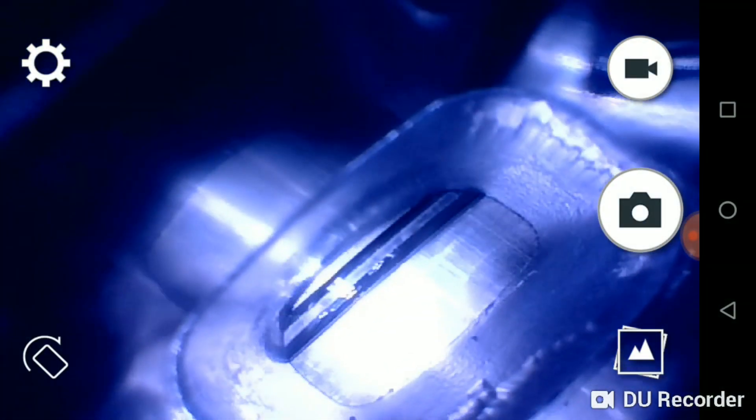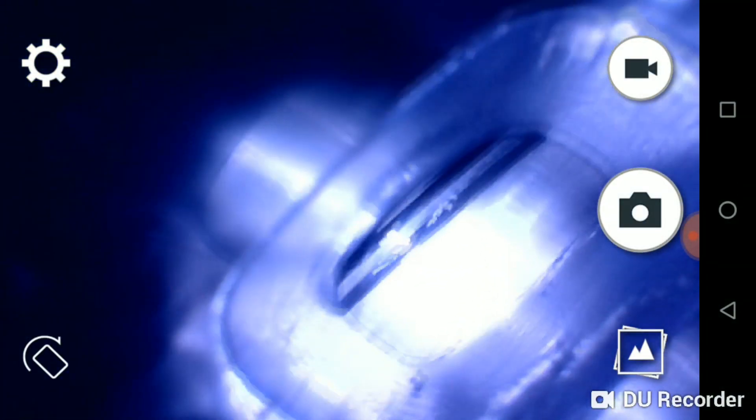The spattering or speckling that you see on top of that piston head is most likely carbon deposits that have been left from the factory test. As we look at the walls, you can see there's not really any scratches, there's no marring. When we take a look at the carburetor side of things, you can see everything looks nice and clean — there's no scratches, no gouges. It's just brand new.